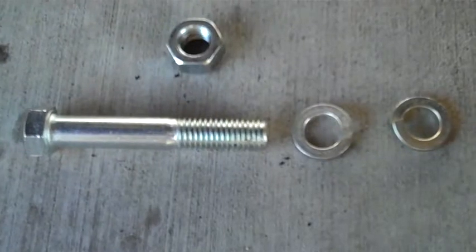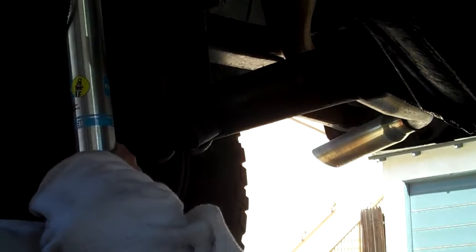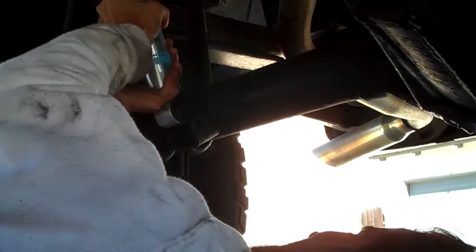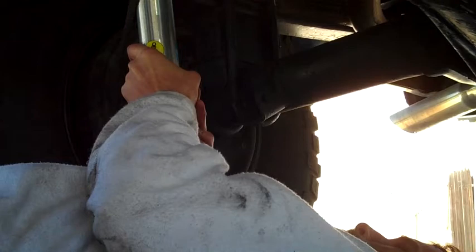Your shocks might be different. For the bottom bolts, I went and bought new bolts and new lock washers — mine are nine-sixteenths. Then you need to put the bottom mount of the shock into the bracket with your new bottom bolts. Here's the second problem after getting the pin stuck: I could not get the shock into the lower mounting bracket. Whoever put the previous shocks on must have over-tightened or used too-small shocks, because the bracket was squeezed in too narrow for the bottom bushing of the new shock.